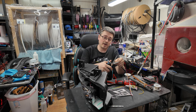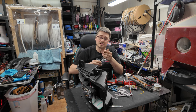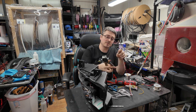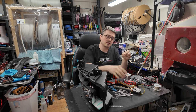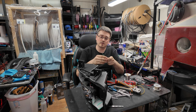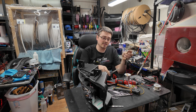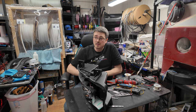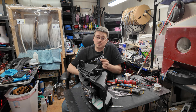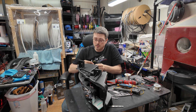And as far as wiring goes, one downside to this style plug, they're generally a little bit lower gauge wiring. So it is like a 22 gauge versus the 18 gauge that I generally like to use. But it's pretty simple to actually just take two wires and double them up and get that same amount of wiring that you need for like an 18 gauge wire. So in the case of this, I have done lights that are pushing almost 10 amps in one light before, and it was able to run over this without any issues. So for the most part, it works pretty well.